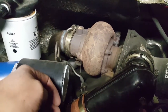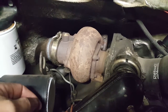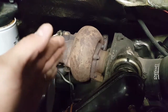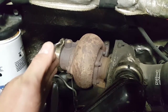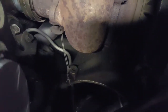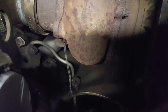This section of the turbo is basically just a big flapper valve that operates in the pedestal, kind of down underneath the backside of the turbo. There's an oil solenoid that opens and closes and pressurizes a piston that acts on an arm to close that valve. It provides a little back pressure to the engine — it's supposed to help with warming the engine up under cold operating conditions. This one I don't think has ever worked. I've got a piece of wire down there just holding that crank arm open so it doesn't find its way shut.